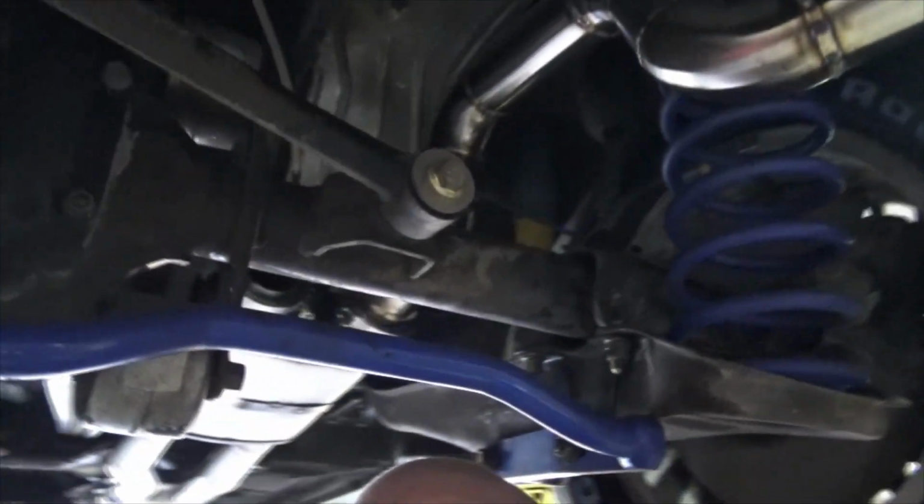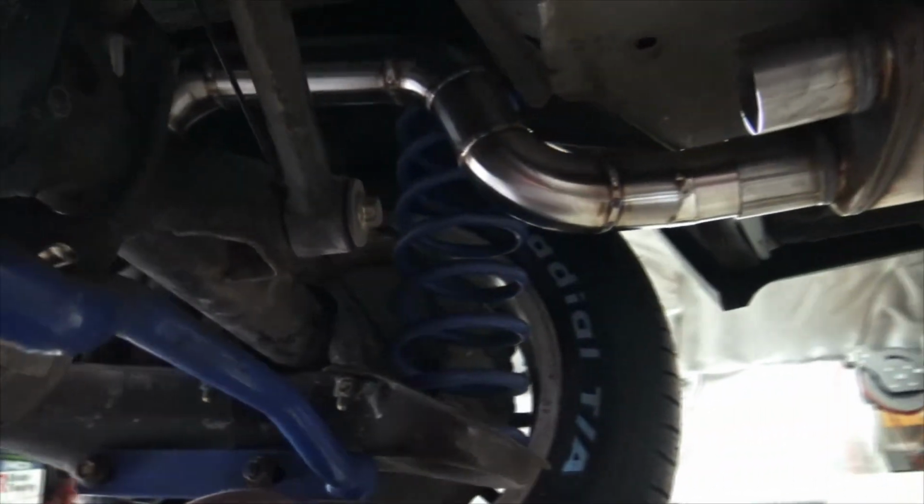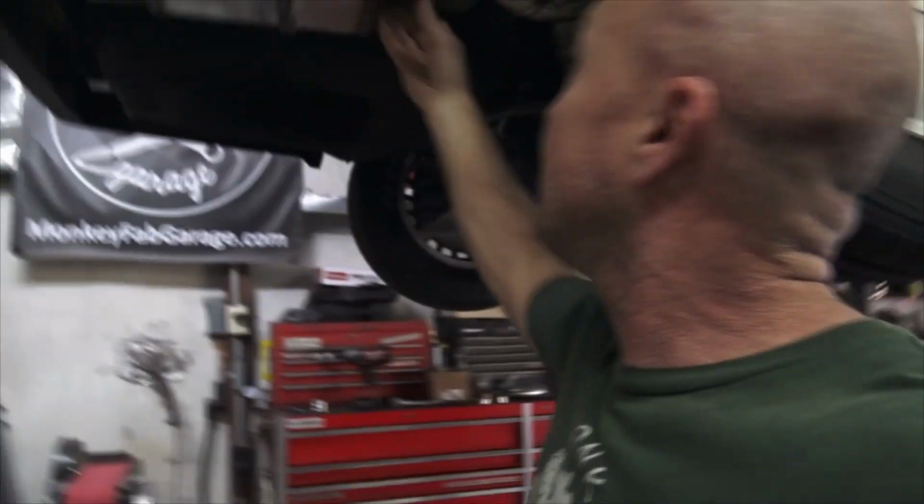Up and over. Just like now. And out the back. So it did move a little bit, not much. So I'm pretty happy with that. It's always good that it doesn't move a lot. Key to that, lots of tacks, moving around a lot. Weld just a little bit, move it, weld a little bit, just keep turning it and get them all joined. Anyway, it kind of moved, I think, if anything, in our favor, maybe a tad.